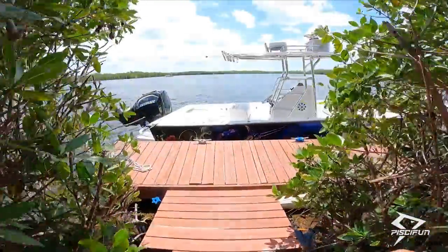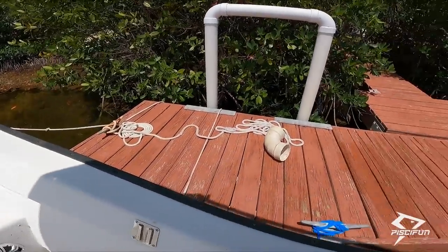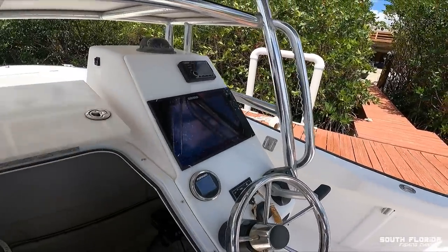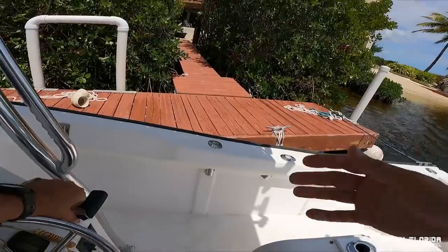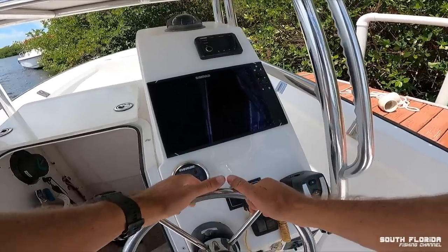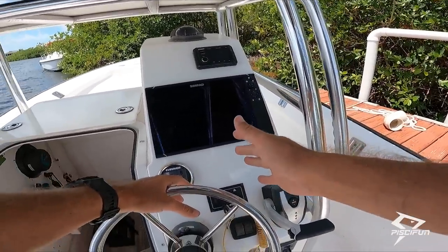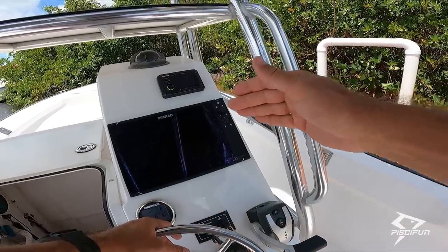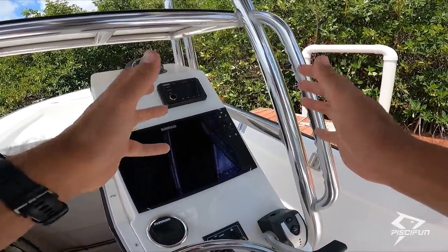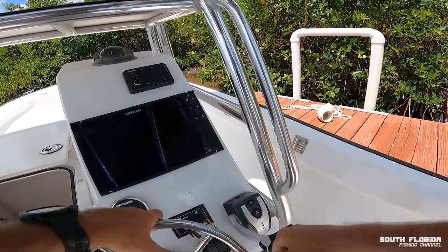So a couple of months before the steering issue, my boat had an issue, or has an issue, but I'm gonna try to recreate this issue while I explain what it is. Lower the motor. If you run the boat pretty hard for 10-15 minutes and then you idle around, for some reason if you're idling at like 800 RPM, it'll go up to like 900 and then up to 1000, and it'll run real rough. Like it'll be shaking a lot, boop, boop, boop. And then if you take it out of idle and put it into neutral, it'll just turn off.